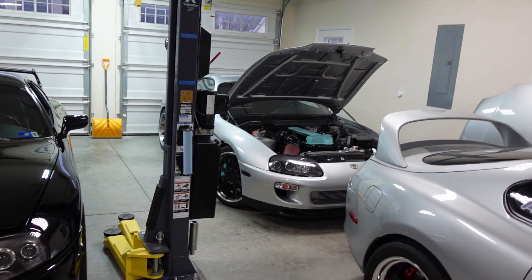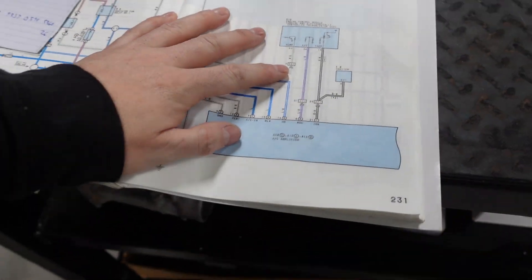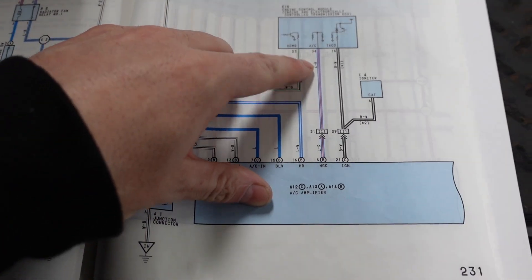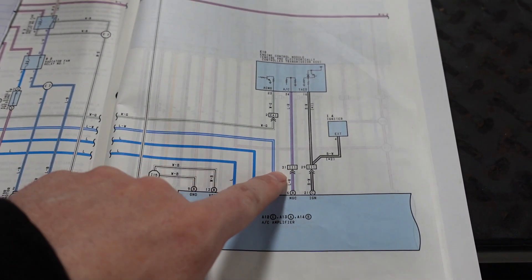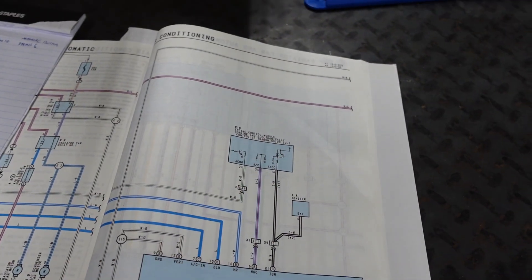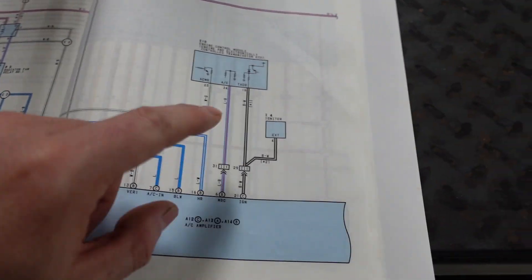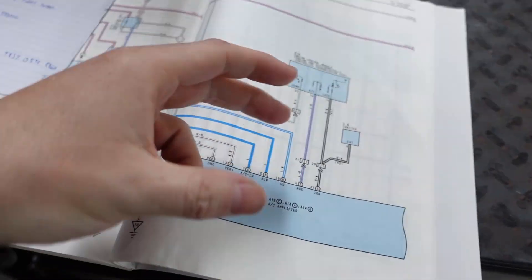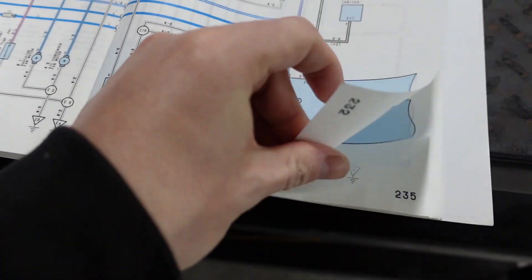Working with Jose Vallia and Bob Wilkinson mostly, we started doing continuity tests going back and forth. This wire here is coming from the ECU — if you had a stock ECU, this is where you'll start for the AC. In my case it's the same color, that's how Jose makes the harness. It'll come from the ECU then to the II1 plug — a white plug with an orange surround around it underneath the car. From the ECU to there, I had continuity. Next up is the II1 up to the AC amplifier. Removed the dash, pulled everything out, pulled the radio out — the AC amplifier sits on top of the radio. Checked the wire from II1 to the end at the AC amplifier. Continuity. Great.